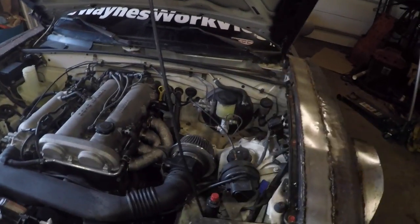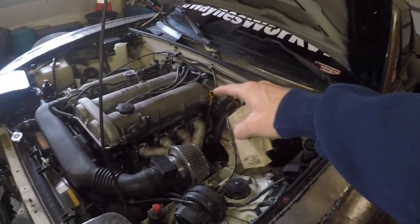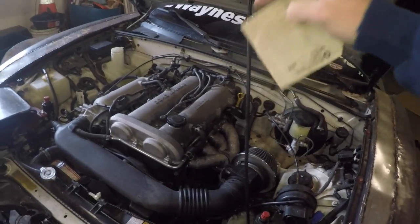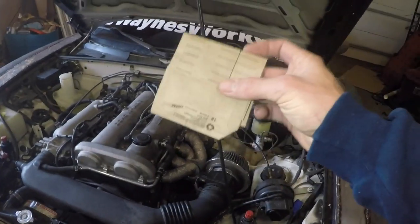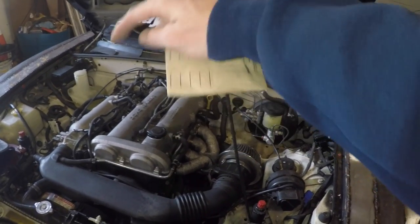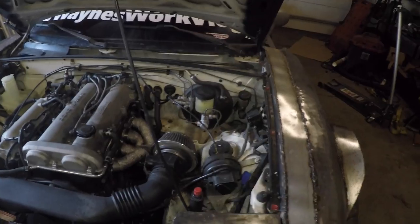At least the life of the motor. If it took 160,000 miles for this O-ring to go bad, I'm pretty sure it's going to take at least that long for the new one to go bad. You might want to do your valve cover gasket as well. If you see oil on any of your spark plugs when you pull them to do a tune-up, you definitely have a leak on the valve cover gasket where it seals around the spark plugs. Mine looks fine — I don't see any leaks anywhere. I'm going to try and do it the cheap way and just do the O-ring since it's the only leak I see.